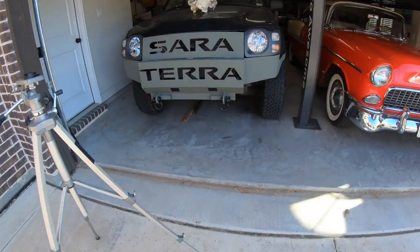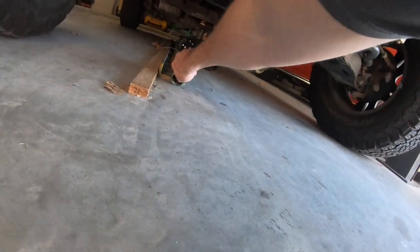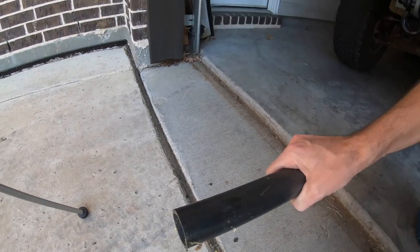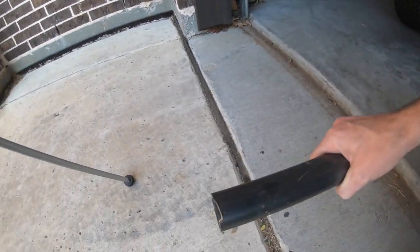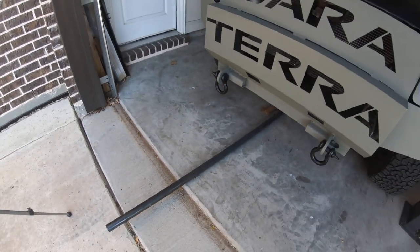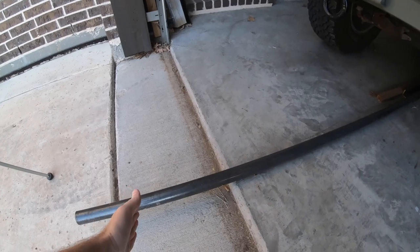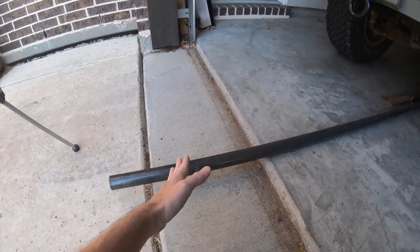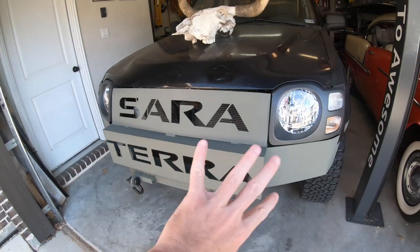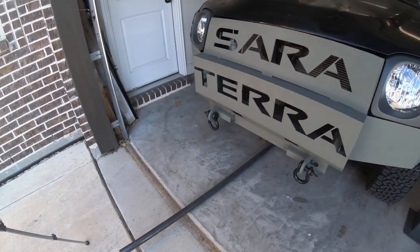And we're going to be making it out of this pipe right here that has been sitting under here forever. This is Schedule 40 pipe, and typically you'd use a pipe bender to bend it. Alan has one of those, but Alan's not here today, so we're going to be cutting our pipe instead and welding it back together. I think that'll look okay because our bumper is already kind of angly, so it'll fit right in. So first step, I need to cut some pipe.